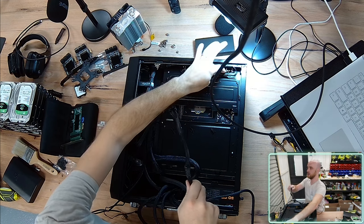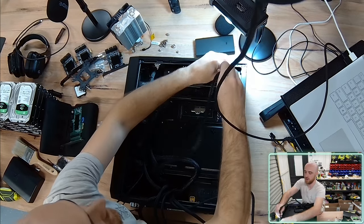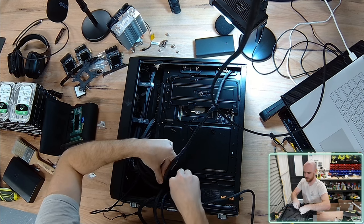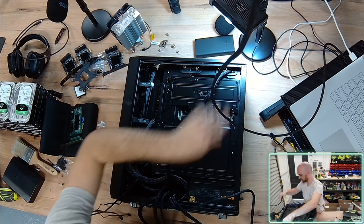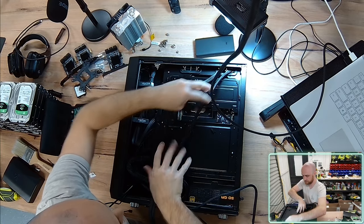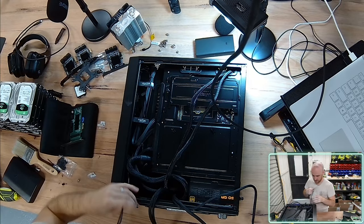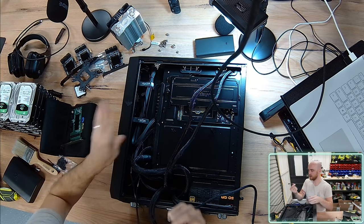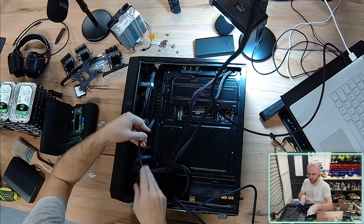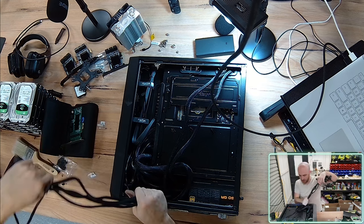Now, these CPU connectors, typically there's provisions on the top side of your case that allow you to get straight to the CPU and have as little of your cable showing on the visible side of your case. Now, this should be okay. This is very janky. These cables are very, very resilient. You can squish them and move them around quite a fair bit. In the back of these cases is normally where you install your SSD drives, but we're just going NVMEs today, so we don't have to worry about any of that. I've got some spare cables from the front case header, which typically provides USB and audio in most instances, and that's what these cables are. So I've got these three that do have to now go somewhere.